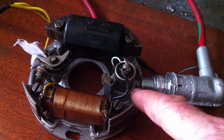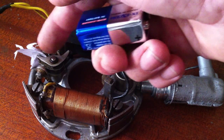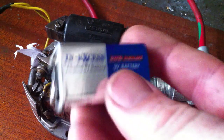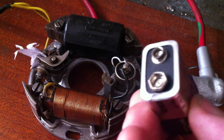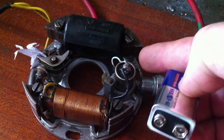We're going to look for sparks here in this electrode gap. I've got a piece of paper in between the points to make sure that they're not closed, or effectively open circuit. I've got a 9 volt alkaline battery in reasonable shape, and the two electrodes I'm going to put between the centre and the outside of a condenser.